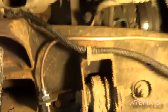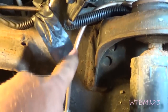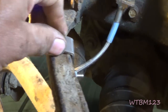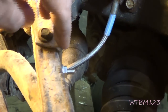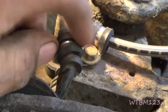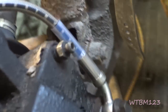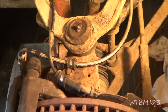You don't have to take all the inner fenders and stuff out - I just replaced the brake lines while it's in there. On the driver's side, I also replaced that line coming in there. It's the same thing - this bracket just bolts on. On this one I did have to take the bracket off the clamp and flip it to make the angle the right way. Up here at the front, they use the front hole on this side, so you put both clamps together and that'll hold the ABS wire plus the brake line - just make sure you've got that clearance.